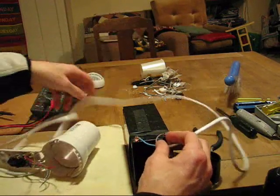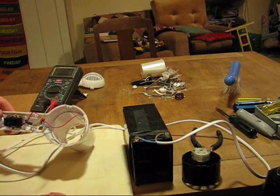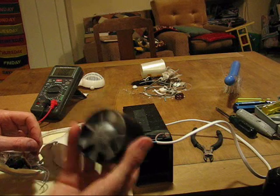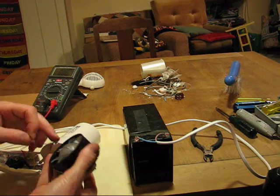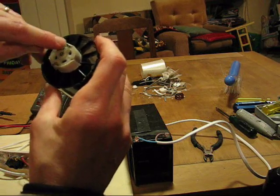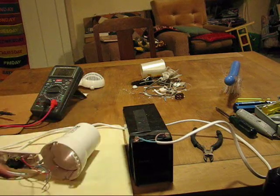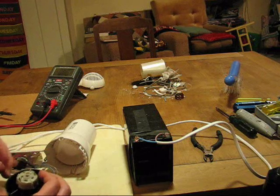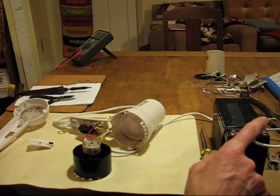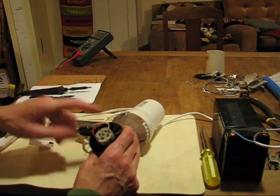I've stripped the ends of the mains cord and connected it up to a 12 volt battery. At the other end I've stripped a little off all these wires so I can test them. You can either do it with a multimeter, or the easiest way is to just try it with the actual motor — keep your fingers away from the fan. If you look on the motor there will be a tiny little dot near one of the poles, and that is the positive. So we've got positive on blue, blue is connected to red, so red should be positive. I've soldered the wires to the motor.